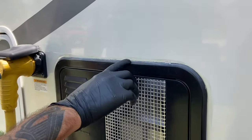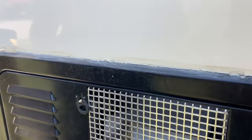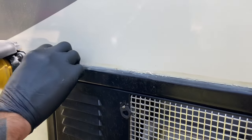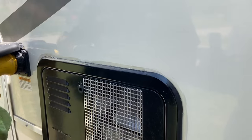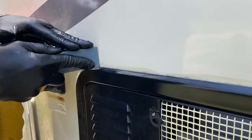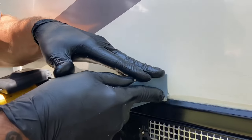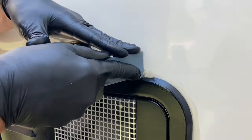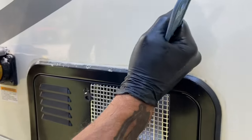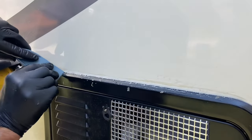Let's get out in the sun and I'll show you how we do this. You can see some of the old stuff right here — you can see it flaking up. That's definitely what we want to remove; it's just peeling off right there. We're just going to spray it with the WD-40, let it sit for a little while, then take your plastic scraper and put a little pressure on there. It comes off pretty easy — it doesn't take too much muscle. Some of the silicone comes up and you can just peel it off in one long strip.